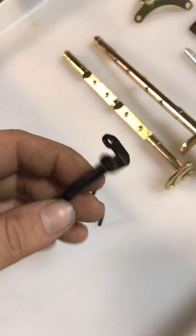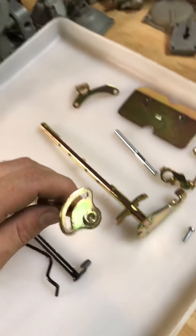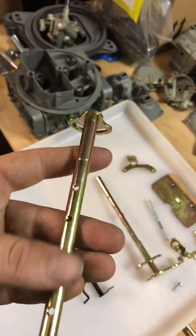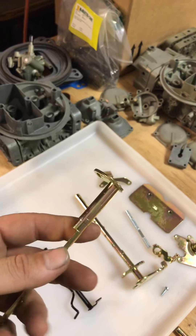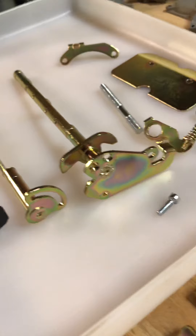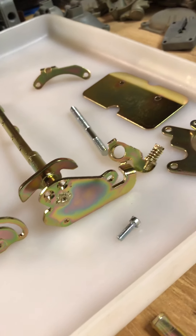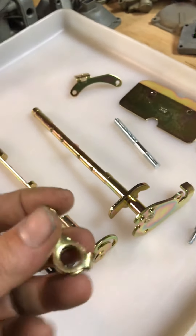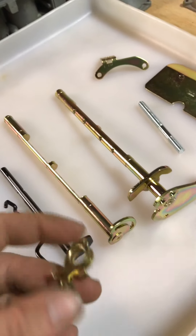The yellow is probably the easiest and most forgiving. Surface prep of the steel is the most important thing — being able to get a reflection like that of my fingernail really helps. In this case the parts were rusted, but these are 50-plus-year-old 1965 parts, so they're actually pretty decent for what they are. The smoother you can get these pieces,